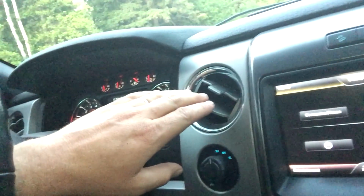Oh, one other thing here too. I don't know whether, when the guys were working on my truck here to replace that timing chain, they had to do anything with the air conditioning system. Especially if the truck's been sitting out in the sun, everything's really hot, of course. As far as I know, traditionally it's about 4 or 5 minutes and it should be blowing some pretty darn good cold air. Well, this is not really blowing really good cold air until you've driven down the road at highway speed for like 25 minutes. And it's still really not that cold. You can actually feel it: put your hand in the vent there, and you can feel it cold. Then it kind of warms up a little bit for about 10 seconds, and then really cold again.